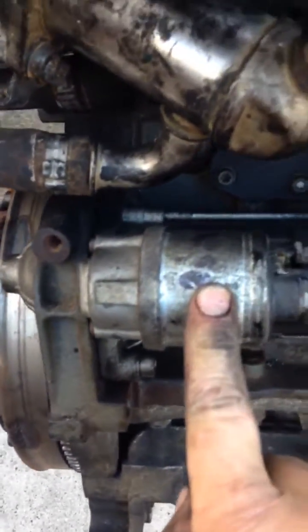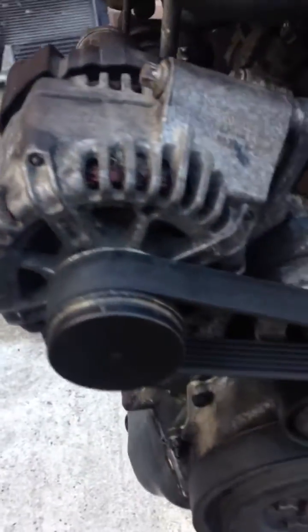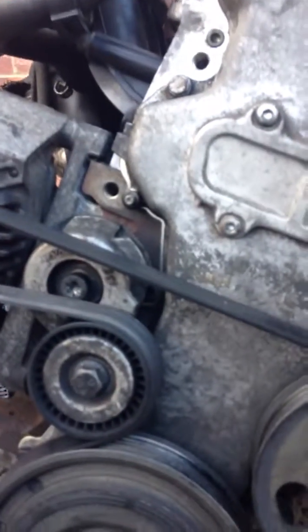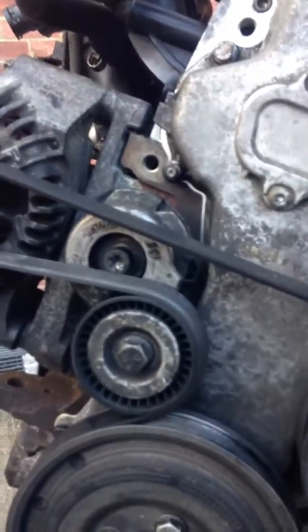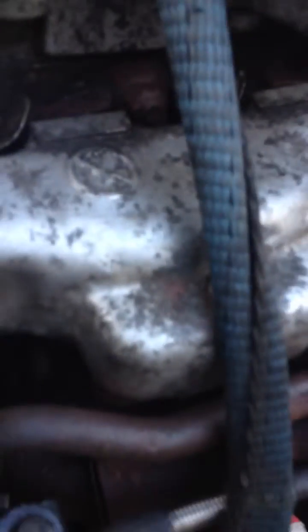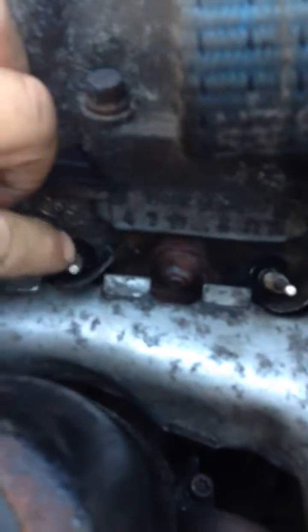What we're going to do - I've also got to put a starter motor in, that's been replaced, I've put that in. Luckily I'm starting to accumulate a few spares now. Let's spin this engine round on my little engine crane. The alternator has gone on and all the auxiliary belts - that's all done. I've turned it over. Before when I got this engine I did mention in my previous blog that it was ice-locked, it was locked up. I managed to free it - it wasn't really seized, it had been sitting around for a little while. What I did do is I took out the glow plugs and put a little bit of diesel oil in there, left it for a few days, let it soak in, and it freed quite easily. So I'm quite happy that's going to go - once she's in there I'll fire her up.